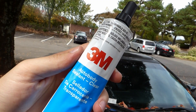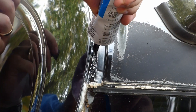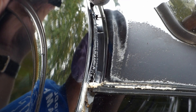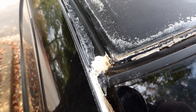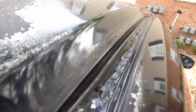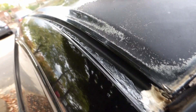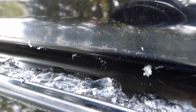I'll just start putting on the auto body sealant — I have everything cleaned up, this is what it looks like. Now I have the auto body sealant on. Put a little bit down there at the bottom. I just put it on pretty liberally because I don't want to have to take that rail off again and try to fix another leak. Just right along that edge. What I'm going to do is clean up a little bit of the sealant from around these little knobs here before it dries — and it actually dries pretty quickly.